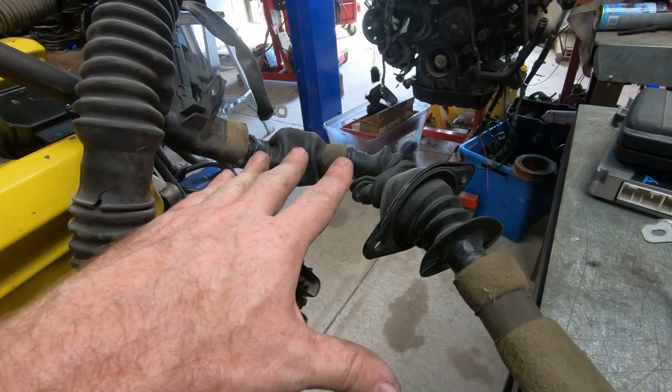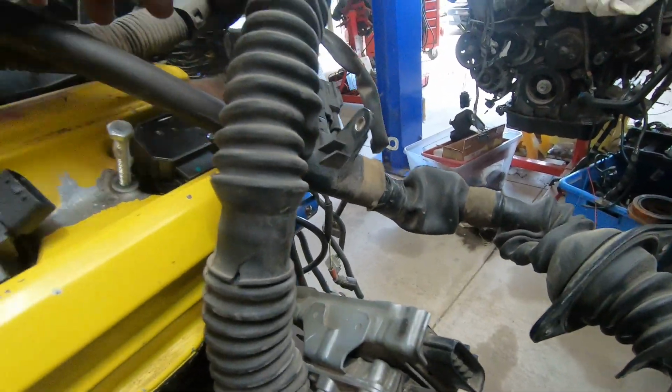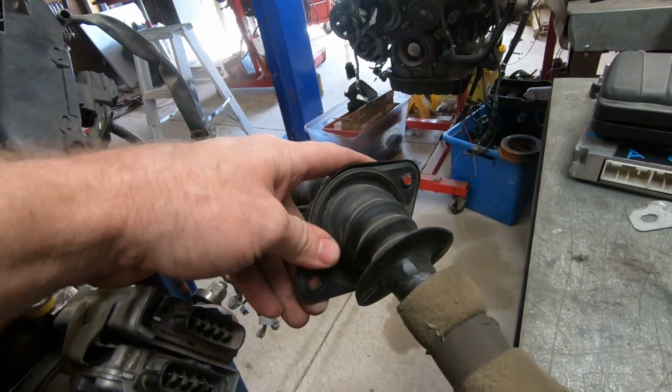Right, let's look at the ECU side. As we come down, you can see there's a little bit of a difference in here. Flexi rubber, flexi, and hard plastic on a clip, different shape grommet. We probably should spend a moment on the body plugs to see that they're different as well. Good way of identifying your looms.